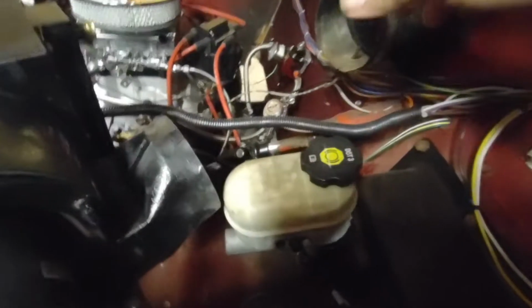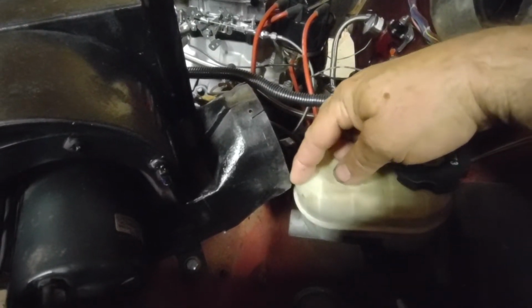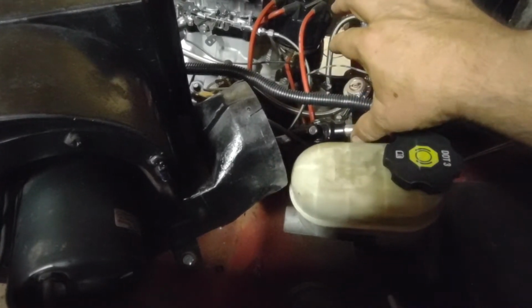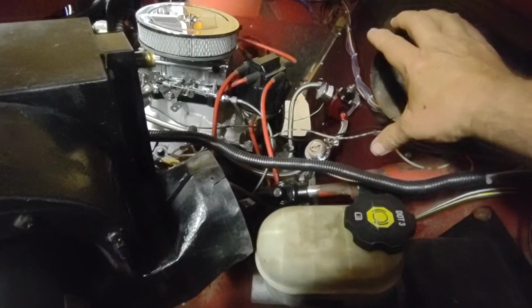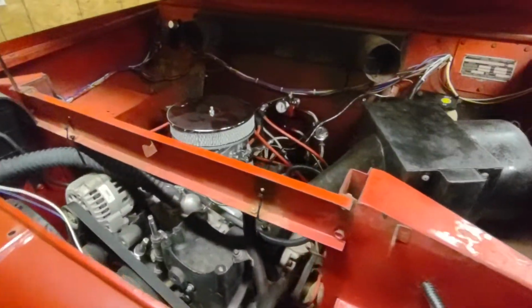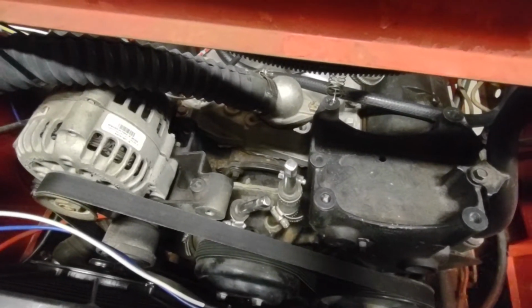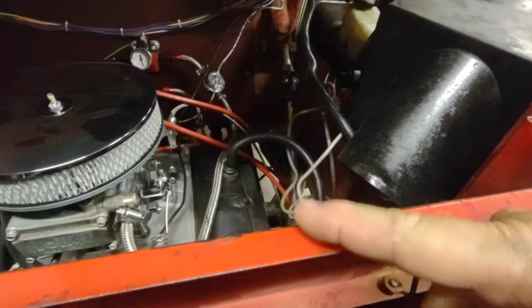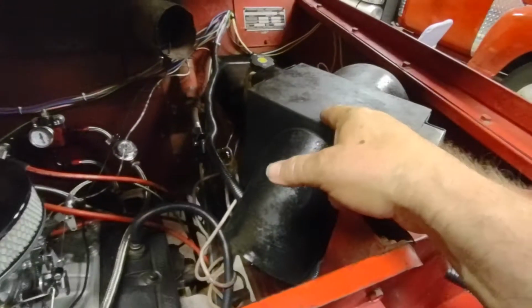What I'm probably going to do is get a piece of metal pipe and notch into the pipe and extend it out here, and then I can connect the flex pipe to there. It's just super tight quarters with the heater box being on this side. I still don't have heater hoses run to it yet. I've got my 3/8 drive extensions plugging the hoses off there. So then I will run heater hoses from there to the heater box.